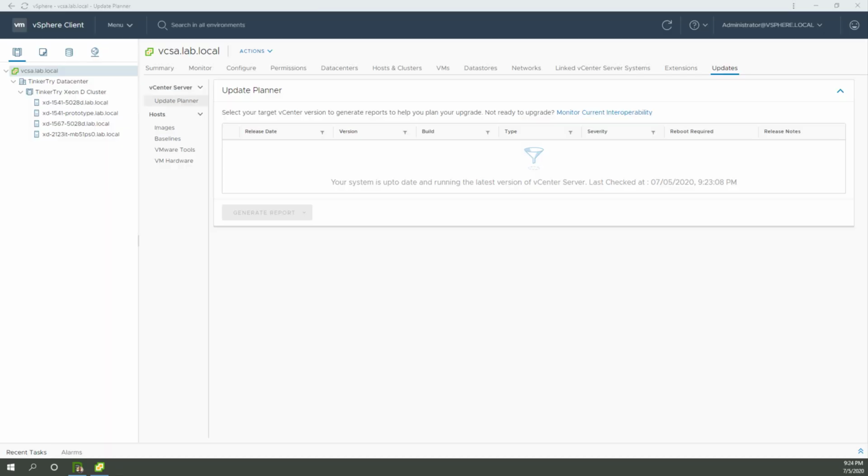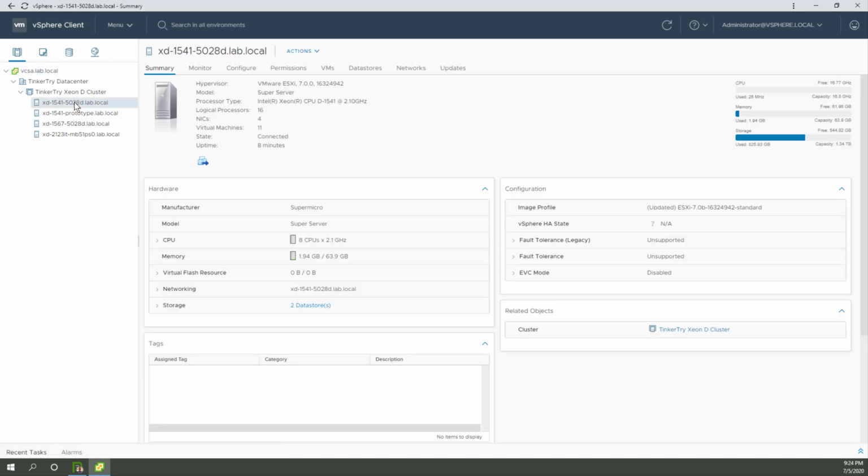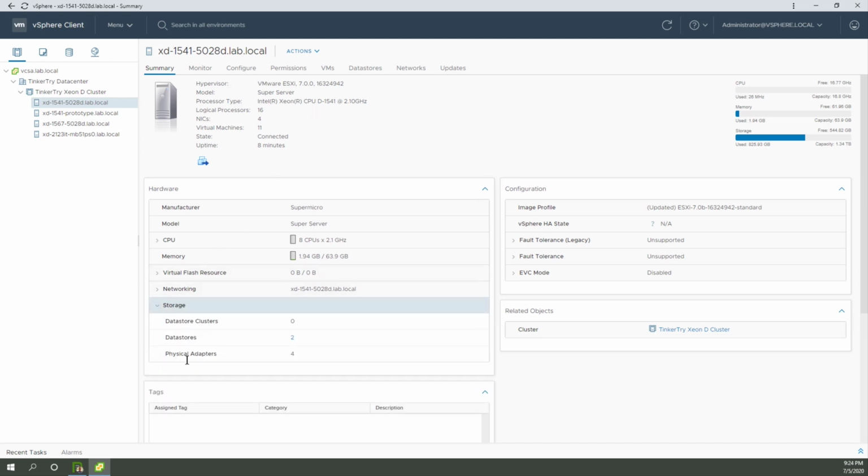Oh boy, this part's kind of tense. My very first time looking at the server after booting it. You see I'm on the latest vSphere, version 7 with the latest patches, but let's get right to it. The summary tab of the host in question. This is my 8-core that you saw with the lid off that has the drive installed. And what we're about to look for is storage. Now, it's not going to show us a data store because we haven't formatted it yet, right?